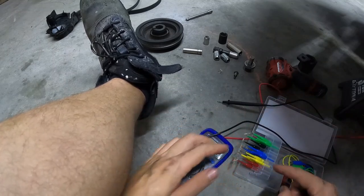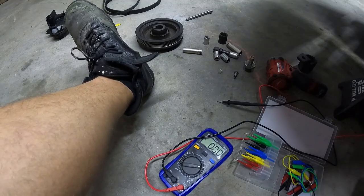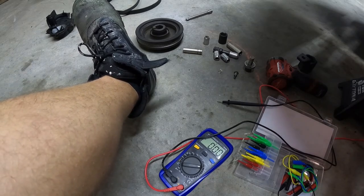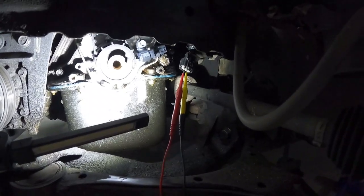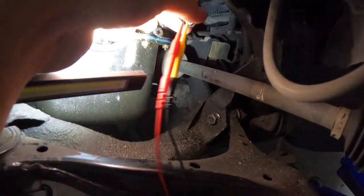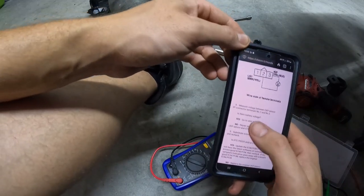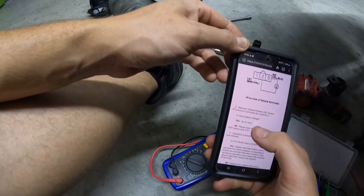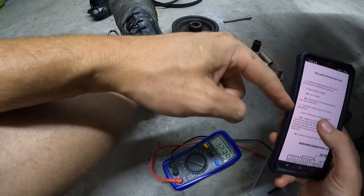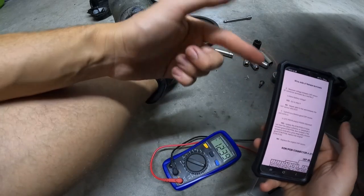This is a great pin probe set — you can buy it from Harbor Freight for about $15. I've got basically the same set from the tool truck for about three times that, and this one is just as good. Probing the yellow/black and the brown/yellow, just as the procedure calls for. It wants battery voltage between those two — and we're reading 12 volts. Yes, go to step 9: substitute a known-good crank sensor and recheck. Which is what we've just done — we put a new sensor on.